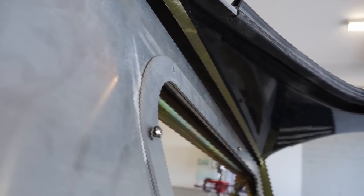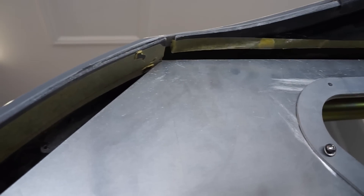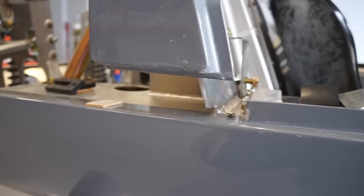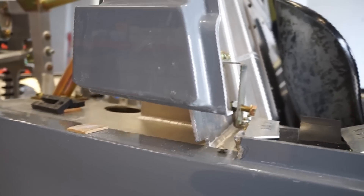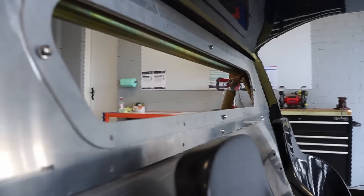I'm starting to wonder about that location — it could be because when I did that markup I didn't actually have the headboard in and I was sort of gauging its offset. It could still be cut right — I hope it's still cut right. If not I've got a nice big gap I can fill with some silicone, maybe even something that's fireproof, so that it really does separate the cab from the engine bay. I'm going to start taking about five to ten millimeters off the sides and slowly trim them back. There is still a little bit to go — probably about an inch and a half pushing two inches here for the rear of the spider still to settle down.